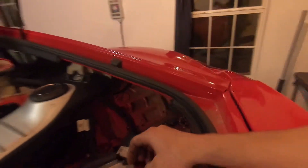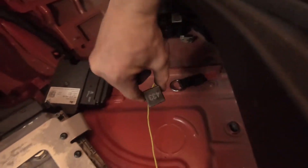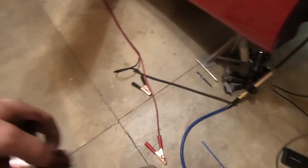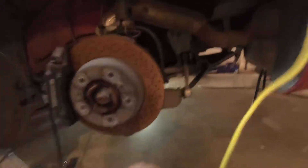Now that I can see that in the cylinder, I just need to bump the starter over. In order to do that, I pulled out the starter relay here from the very bottom. It just connects right here at the very bottom connection on this socket. Then I put the ignition key out of the ignition. I got the battery cable hooked up here to the positive terminal on the battery. And then all I have to do now is take that wire from the back that's going to the starter relay and connect it to the jumper cable.